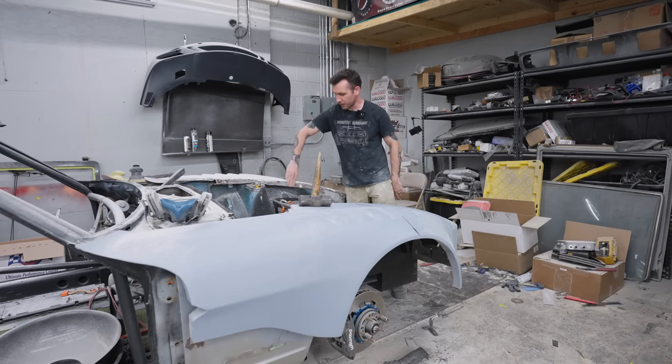But I need to go underneath here so there's not a bunch of air flapping this up. Probably throw a couple really shallow bolts through there. And then there is going to be a little shelf inside the fender that's going to stiffen this corner up. And then this will mount slightly farther back like that. And then this will all get cut out just a little bit back behind this edge. And then our LED light will sit back here with a little polycarbonate lens right in here.